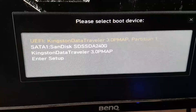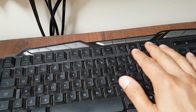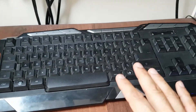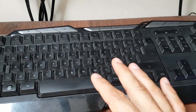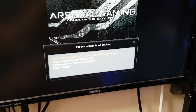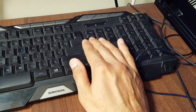I can click on this to select that. For your particular motherboard you may have to press F12, F8, the ESC key, or another combination of keys — check your manual for boot order selection. If that doesn't work, you may want to restart your computer and enter UEFI or BIOS. You may need to press the Delete key, or on rare occasions something different; on a laptop sometimes it's F2. Check your manual.